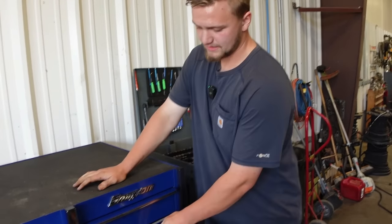My ratchet drawer — it's so huge and it's pretty handy. I've gotten a motor unseized with that — three-quarter wouldn't fit to bar it over, so I stuck this in there. I like Snap-on ratchets — this is probably my only other brand other than Snap-on, but Snap-on's my go-to. I didn't think I'd see any quarter-inch stuff in here. It's there for some brake systems — on disc brakes there's a little 10mm thing to back the brake off when changing them.